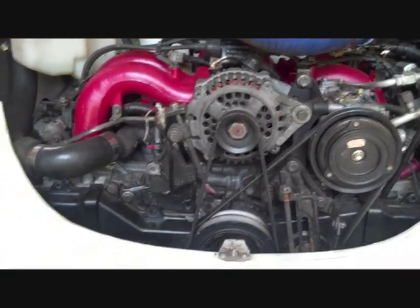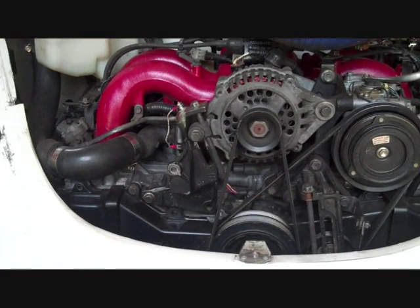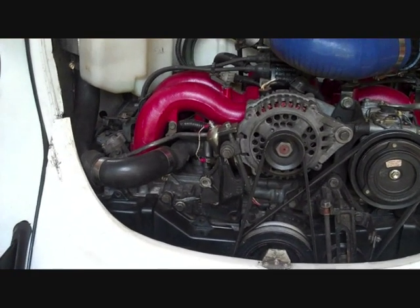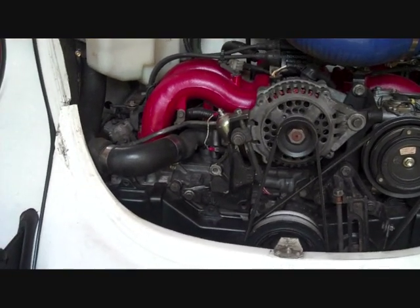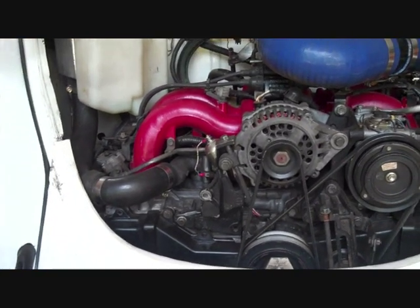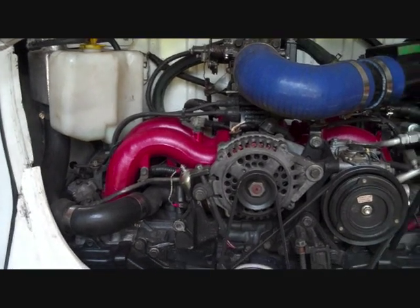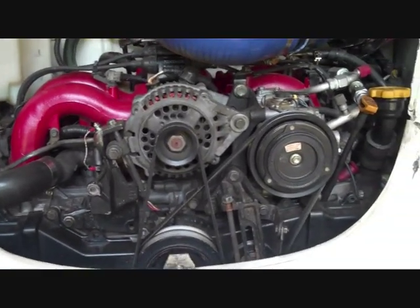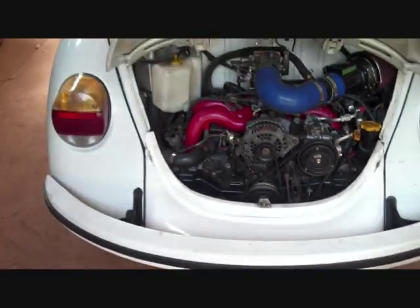It's a little step up in horsepower but that extra stroke just makes for a huge torque increase — about 230 Newton meters. So it pulls like a freight train up hills, never have to worry about dropping back a gear. And amazingly it's been so good on fuel. I thought it would be a very thirsty monster, but still averaging 9 litres per 100, which is about 32 miles per gallon. Not bad for triple the original horsepower. I've got to do some more videos on it.